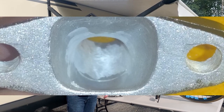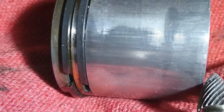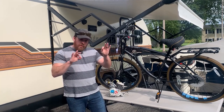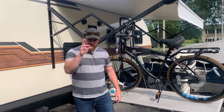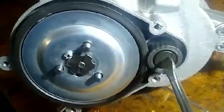When he took the intake off, he marked where the piston was at its lowest with a scribe, took the piston out and ground her smooth, just so it has a clean channel of fuel mixture. He polished up the skirt, putting little knife edges in, so things flow right by. A little smoother, it's better than nothing. He lubed up the primary gear, gonna make this thing spin a little faster. Primary drive gear is bone dry, not for long.